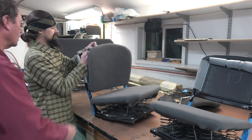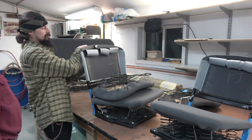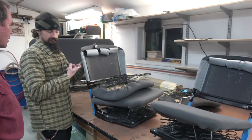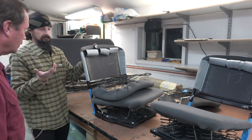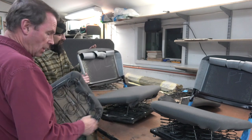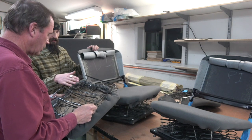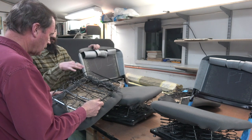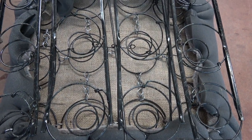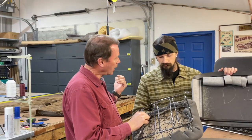These straps will essentially loop up through the spring, and once that's holding onto the spring and comes around, it gets clenched with a tack into the panel board. The tack will actually act as a staple. You've got to do it like putting soles on a shoe — you can mangle a staple if you staple steel, it just doesn't work the same. Are these original springs? Yes, all your front seat springs should be original. They're heavier gauge down in the cushion. You went through and rebuilt all this stuff — you used burlap, and what's this? That's just a jute padding, in place of the cotton from the original.